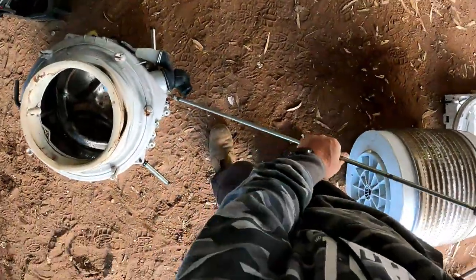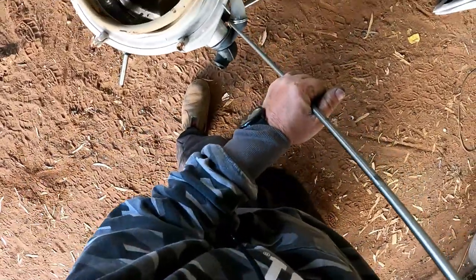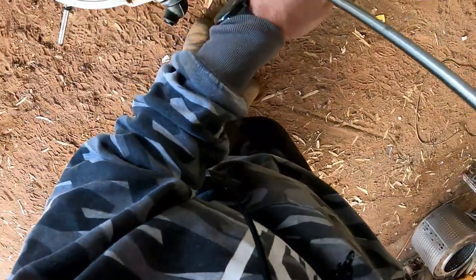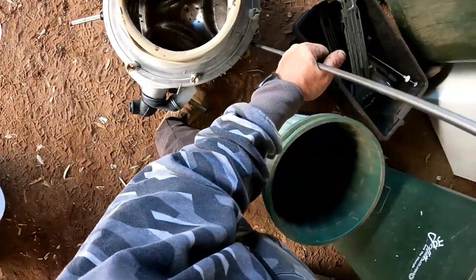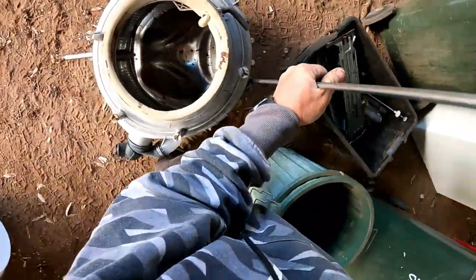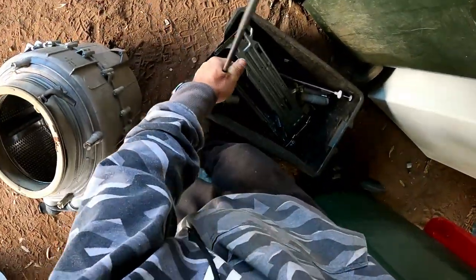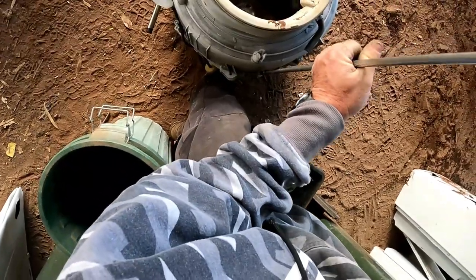Oh, E10. That's a water problem. Nothing there. I'll have to attend to that, Sean. I'll get to it. Finish this off and we'll get it all fixed. What the problem is, it's probably just a diaphragm gone. I've got spare ones of those. They don't last very long.